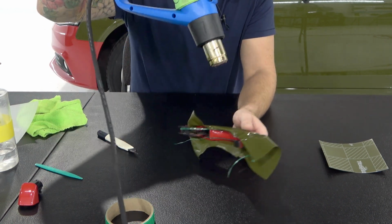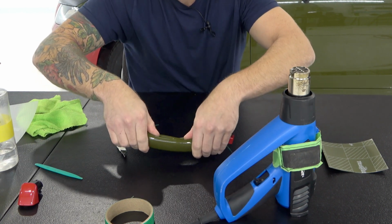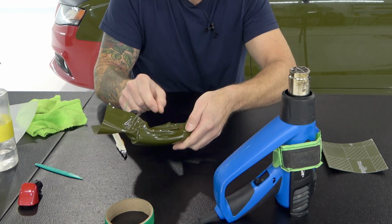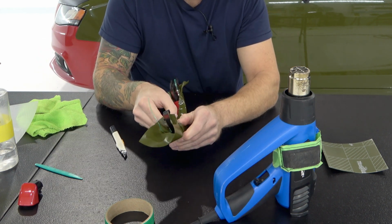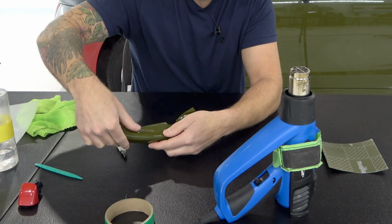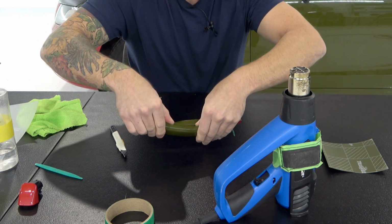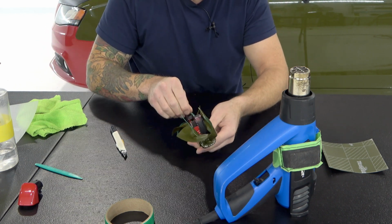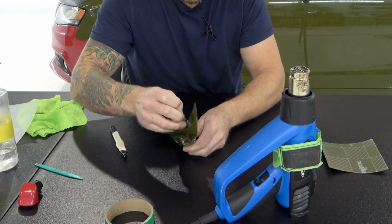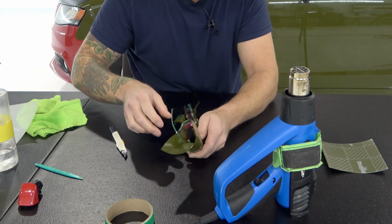Now what I like to do here again is just heat these corners right here, and we're going to push those areas in first. This takes tension away, or it pulls tension across the middle area right here. So instead of working from the middle to these areas here, we're actually dispersing our tension way more evenly when we do it the way I just showed you, pushing down in these corners first. Okay, this is actually ready to be cut on this side with the knifeless tape. Let's just place our cut tape here and make sure that it's going to pull through really nicely.